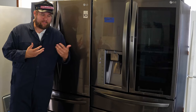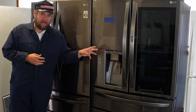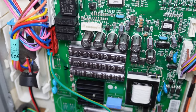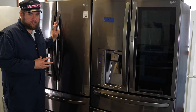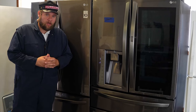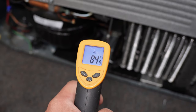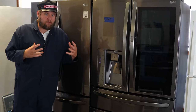If it's not the board or a sensor at this point, you likely have something beyond a DIY fix. Now for conclusions: on this first refrigerator, the board is clearly bad. It also has the ER F error code for the evaporator fan, so I'll replace the PCB first and see if that resolves the issue — otherwise I'll replace the fan. Surprisingly, during this video we found that the second refrigerator is showing warning signs of losing refrigerant: it's not getting as cold as desired, the condenser coils aren't getting as warm as they should, and the frost pattern in the freezer is good but not great — suggesting it needs a refrigerant recharge and likely a new compressor.